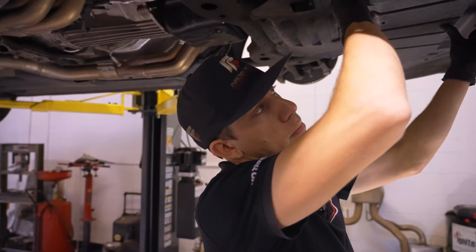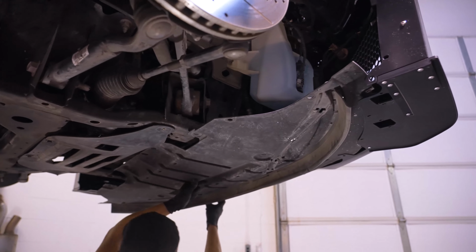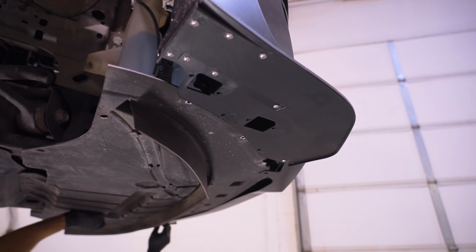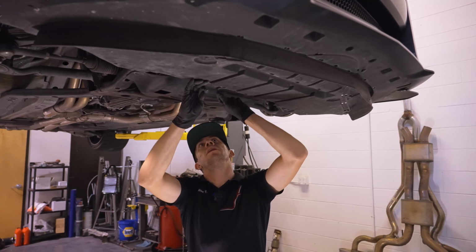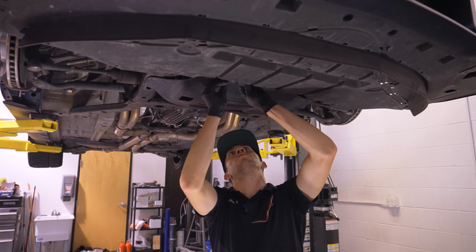Basically, you're trying to make sure you make it over the sides, but under those clips in the front. So it should kind of feed into the lip of the bumper more or less. So basically what I'm using to line it up are these two clips that you can see visibly. And then I'm gonna go ahead and get two of my rear bolts started once we're pretty close to straight. That way I can actually let go of the under tray.